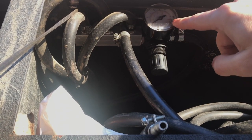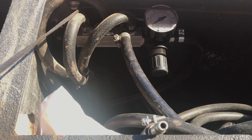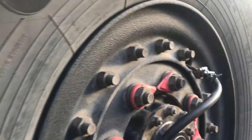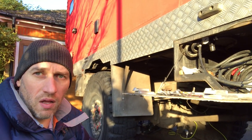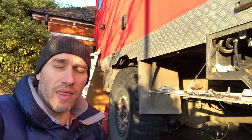For example, if I want my front tires at 90 PSI, I put 90 PSI on this gauge, walk away, and I know the front tires won't go beyond 90 PSI. If I was to build this system again, I would have two gauges, because ideally the back tires run at a different pressure to the front — maybe fronts at 90 or 100 and rears at 120. At the moment I have to set the front to 90 or 100, then disconnect, change it to 110, and let the backs inflate.